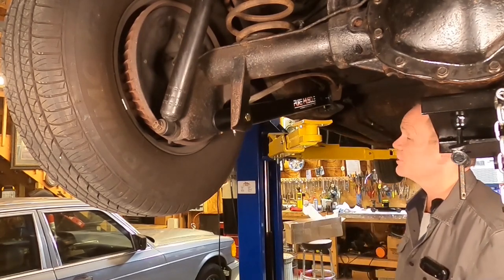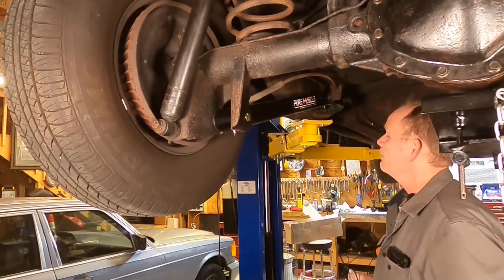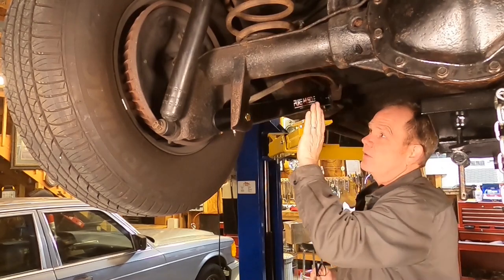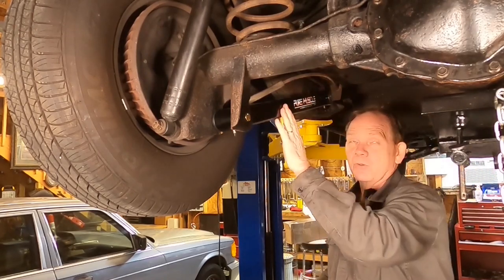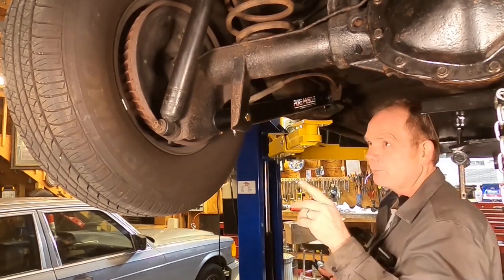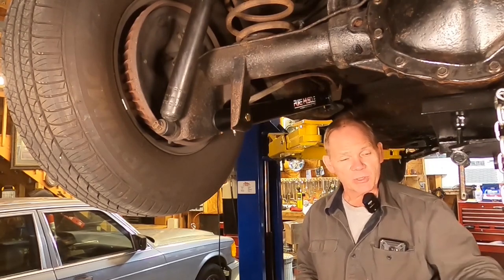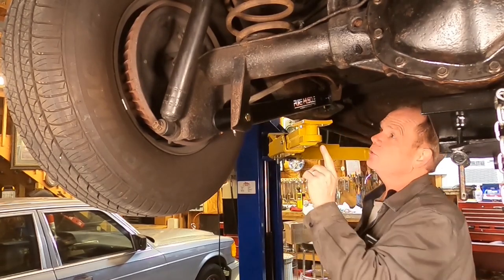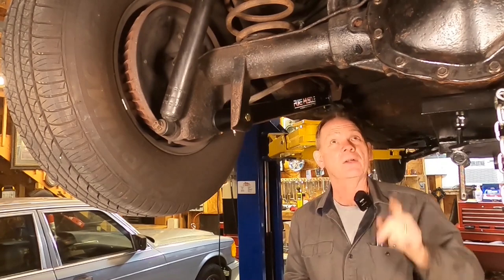The only issue I had was this: keep in mind that your rear axle is under spring tension. So if you take the old arm off, you need to have your jack underneath the diff to keep the axle from rotating as you pull the arm off. Or you could take the springs out or put a spring compressor on them. It might be a little bit of a challenge to line up the holes since you're under spring tension — you'll have to manipulate the jack somewhat, raise it some then lower it to get the holes to line up. I'm going to go ahead and do the other lower trailing arm off camera, and then we'll move on to the upper rear trailing arms, which are adjustable.